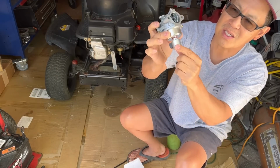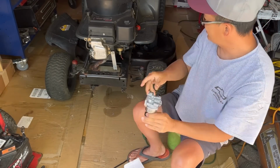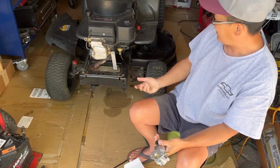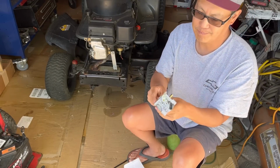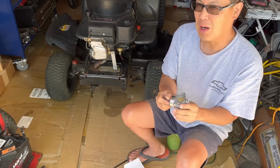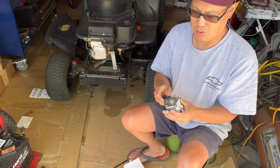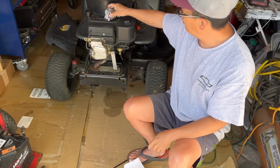As you can see, this does have a fuel solenoid on it too, but it has the plug-in type, which is different from this one, as this fuel solenoid has a wire coming out of it. So I have to rig these wires to fit this type of pigtail. Or I could just take this fuel solenoid off and replace it with this one, just to see if the problem was the gasket and not the fuel solenoid. I should try that first because it's less work. So I'll install this after I go and walk my dog.